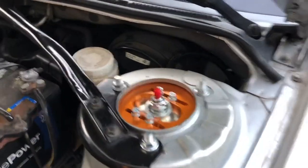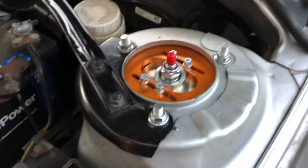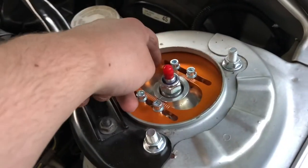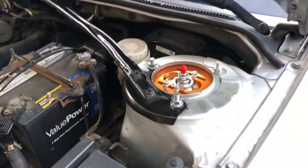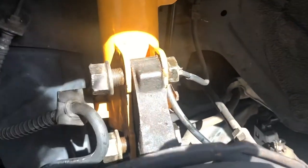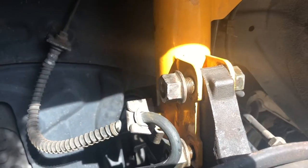So these are just three bolts - this one right here, here, and here - just got to take those off. Then the pillow ball mount is right underneath this orange piece here, so I'll have to get to that and grease underneath there and hopefully it solves our problem. It's now the next morning and I've been taking out these things - they're really tight in my car.